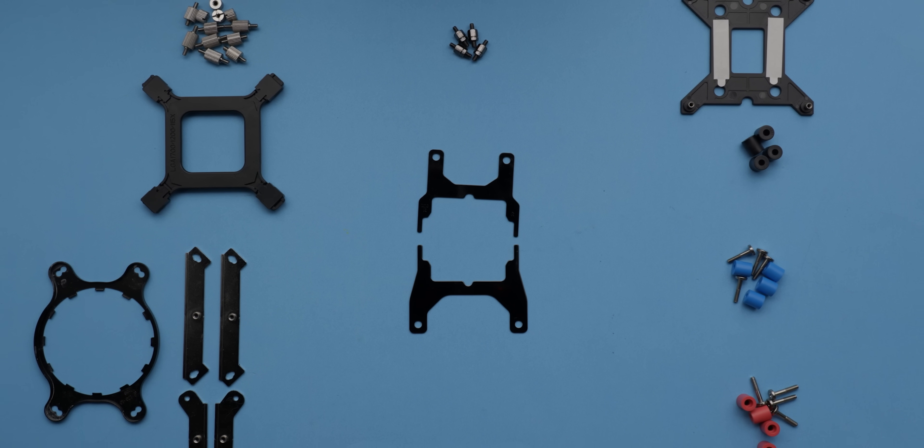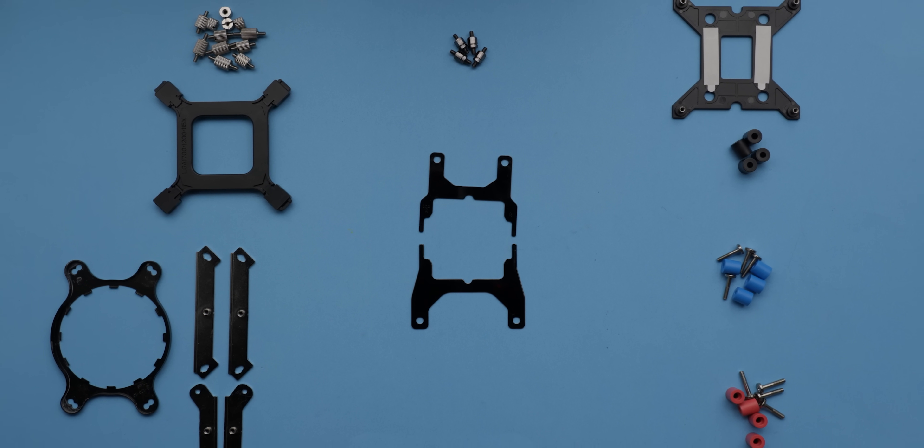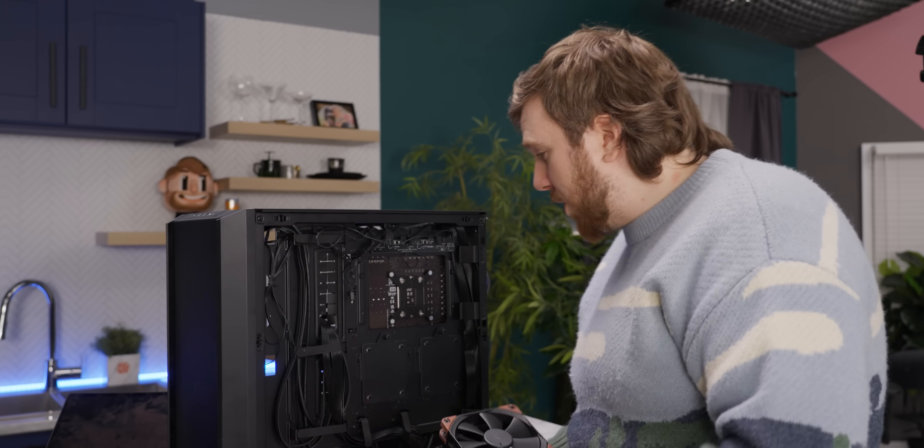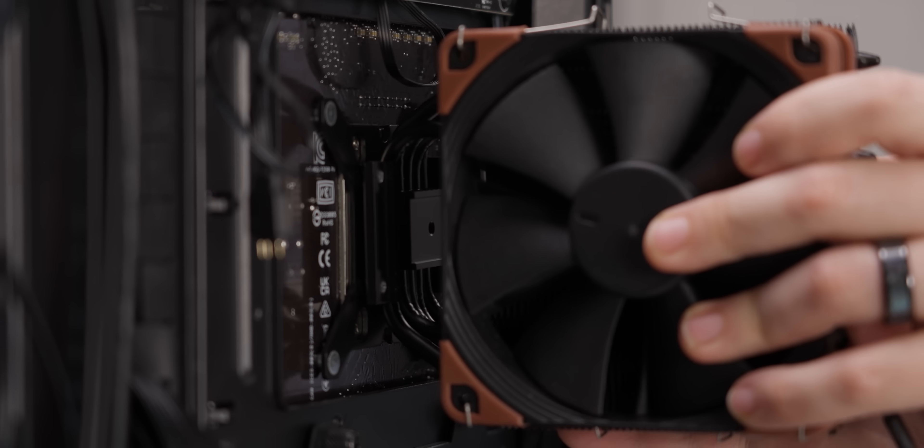So let's see how easy or hard it is to mount a cooler on the back. Any mounting design we make will need to make sure that the CPU cooler on the front isn't affected — because spoiler alert, it's doing most of the work. Mounting hardware for CPUs is made with relatively tight tolerances to ensure even contact across the CPU's integrated heat spreader, and pretty much every part plays an important role, including the parts on the back of the motherboard, which are in our way.